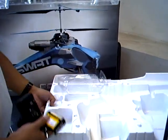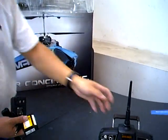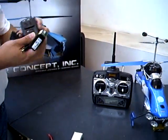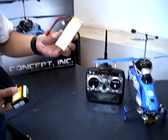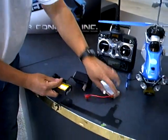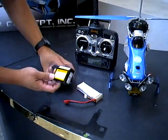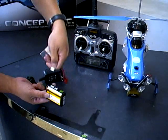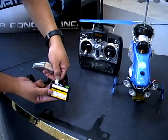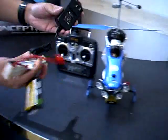Let's continue to discard the plastic and show you how to do the charging on this lithium battery pack. One end goes to the plug of the bridge adapter, and then the other end goes to the larger portion of the three-cell balance charging plug. Before you plug the battery in, plug into the AC outlet first.